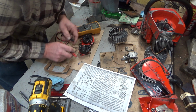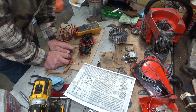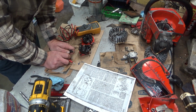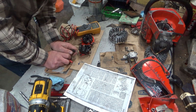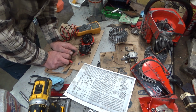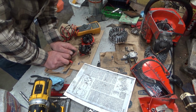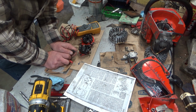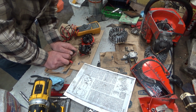Okay. Now it talks about a further check. Remove the spark plug, reinstall the rotor, leaving the G disconnected. When G wire is that one over to this module. Connect a positive red from the voltmeter to the G from the generator. Yeah, this is ridiculous. We're not doing that. This sounds like a giant pain in my ass, and I'm not going to go down that road.